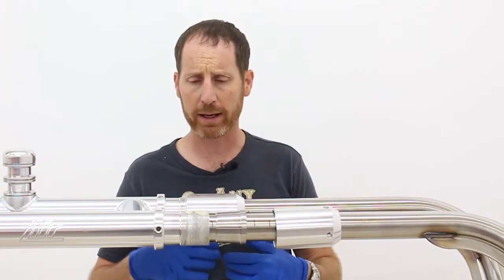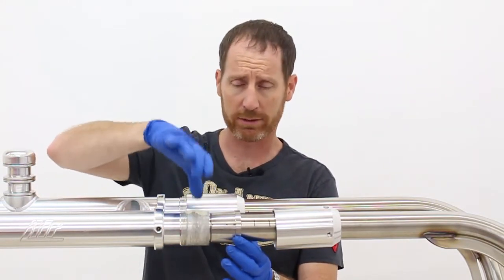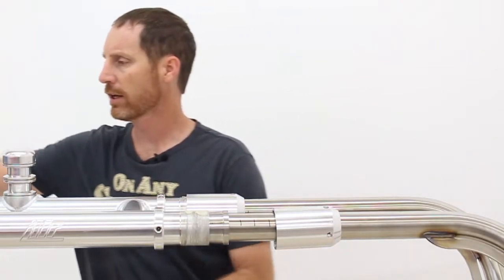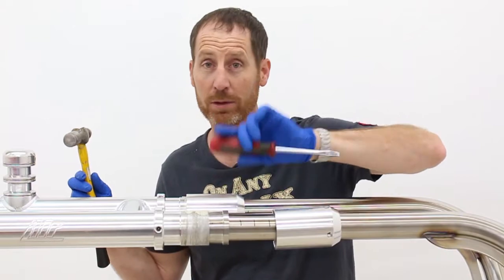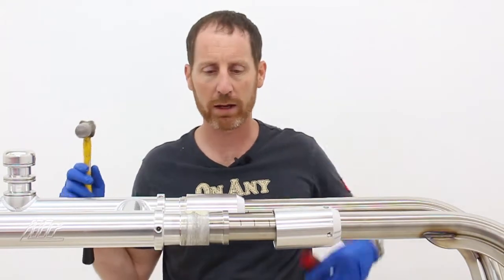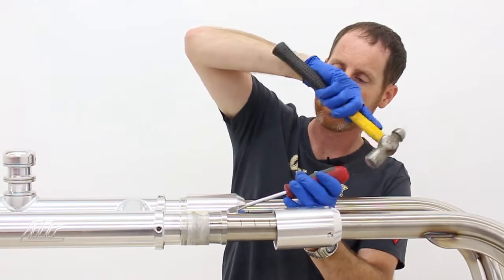We've already done the back, and so all we do is, once again, with set screws set evenly because we want it centered there, we just slide this collet in, and then I would actually, just to go on the boat, go ahead and just gently tap it. Now, I'm using a screwdriver because I know most people at home are going to use a screwdriver. You should use a chisel, but I know how it goes. Let's be real. And so we're not having to drive this very hard. I'm just going to do a few taps just to show you how friendly it'll go in.